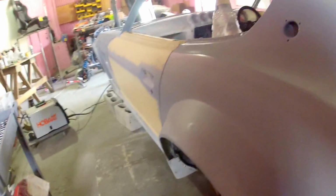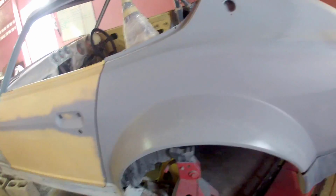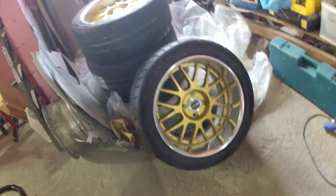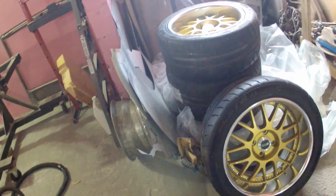They're pretty wide, and we had to go wide with them. They're originally normal bolt-on flares that we then had fiberglassed into the fenders to give it a nice molded appearance. As I said, the reason we had to go wide is because of the wheels we're running. These are SSR three-piece forged, 10.5 in the back, 8.5 in the front. Definitely would not fit under the original fenders, and we needed a little bit more grip, a little bit more rubber.